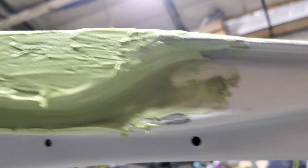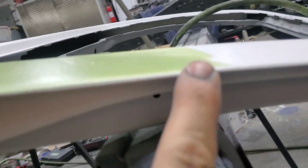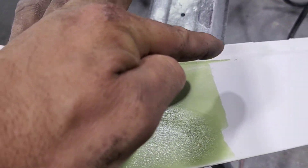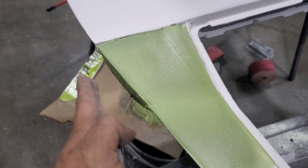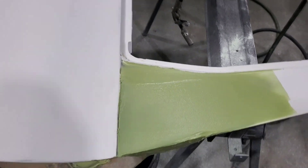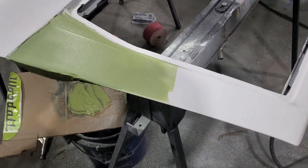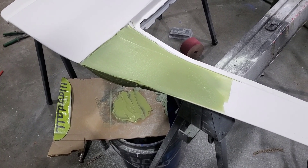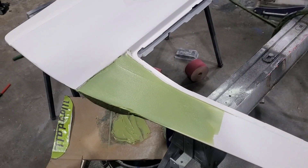I'm going to use my finger down here with a piece of sandpaper, and use the block for this edge — trying to get the roundness to match the edge all the way down. You have to keep it flat here and right on that edge, but also keep your roundness and edges correct. I've started on the other door — got it cut out but not bent yet — I did that while the first coat of bondo was curing. This whole start of video has been less than two hours, so it doesn't take forever.